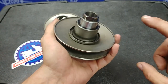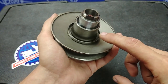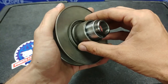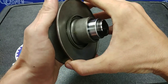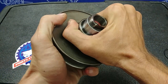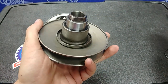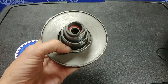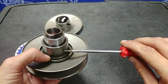What we need to do is remove this spring base from the torque driver. When these things are put on from the factory, they're kind of press fit. There's two O-rings underneath of it to seal in any grease that's underneath. Sometimes you can grab this with your hands, twist and pull, and it'll come off — but ninety percent of the time that's not going to happen. So I'm going to show you a little trick using a flathead screwdriver to get this off.